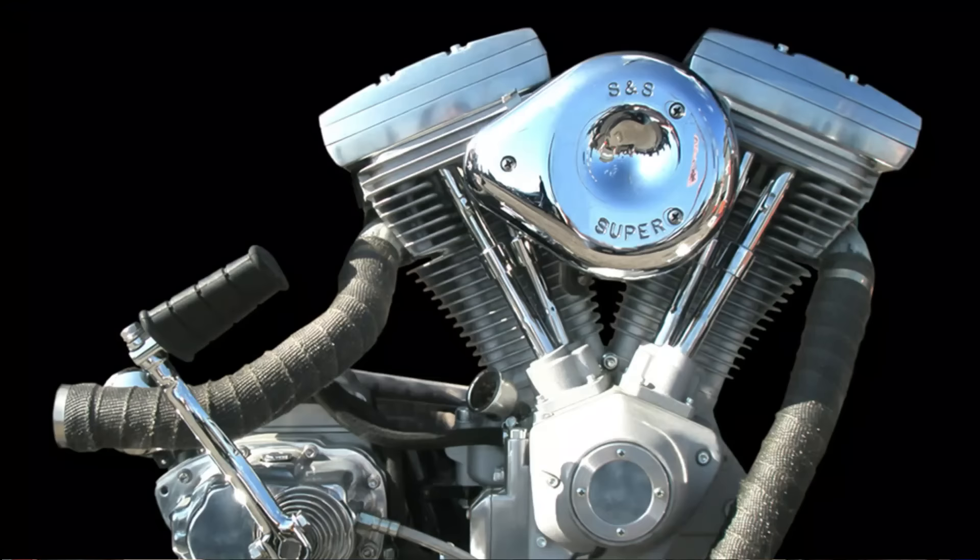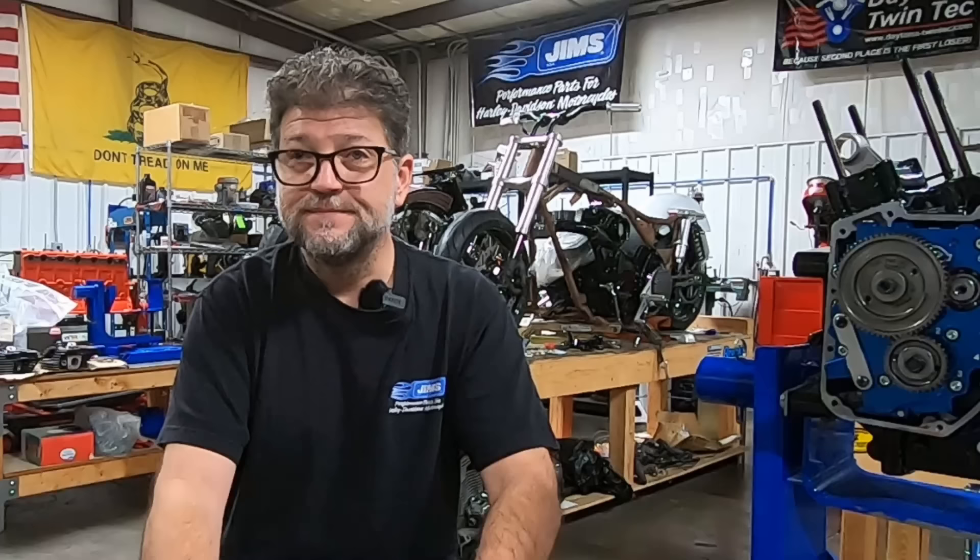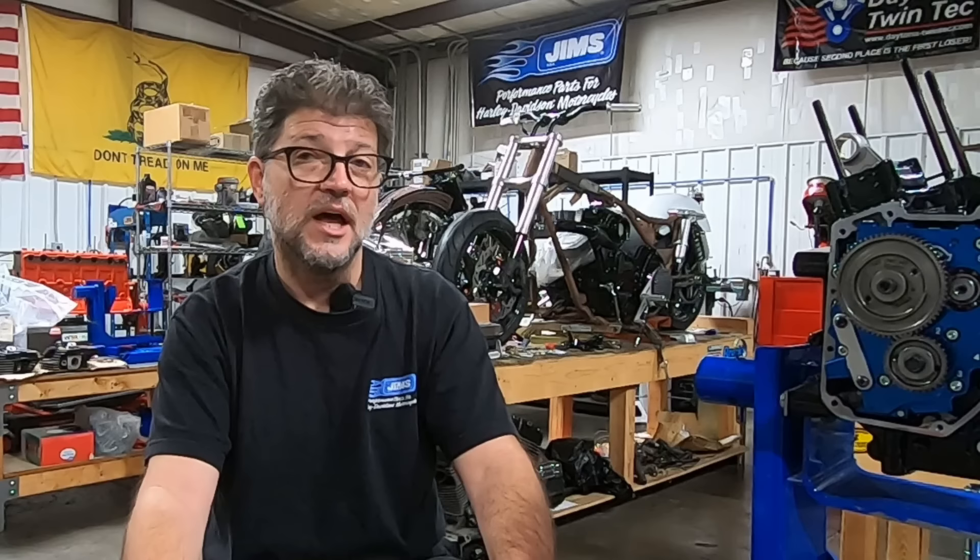For the next generation of engine — and the one most would say saved Harley-Davidson from bankruptcy — was the Evolution. The Evolution engine was first introduced in 1984 and it ran through 2000. It came in at 1340 cc's, and as a side note, even though everyone calls it 80 cubic inches, that's actually 81.7 cubic inches — but 80 sounds better. After the management buyout in 1981, the Evo really did set Harley on a new path with a more reliable engine, increased power, and reduced cost of ownership.